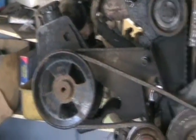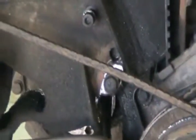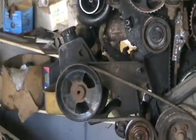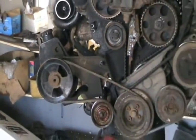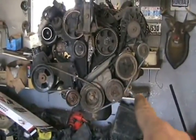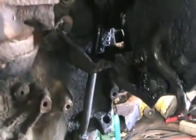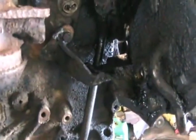I just got done repairing the broken bolt in the power steering bracket and a bit of the broken-off flange. So there's what Chrysler power steering looks like on a Volkswagen — the pump is on the opposite side; if it was Volkswagen, the pump would be right there. It's a modified four-cylinder Chrysler power steering bracket with an undercut piece in it to clear the axle when the suspension hits big bumps and the axle moves up.